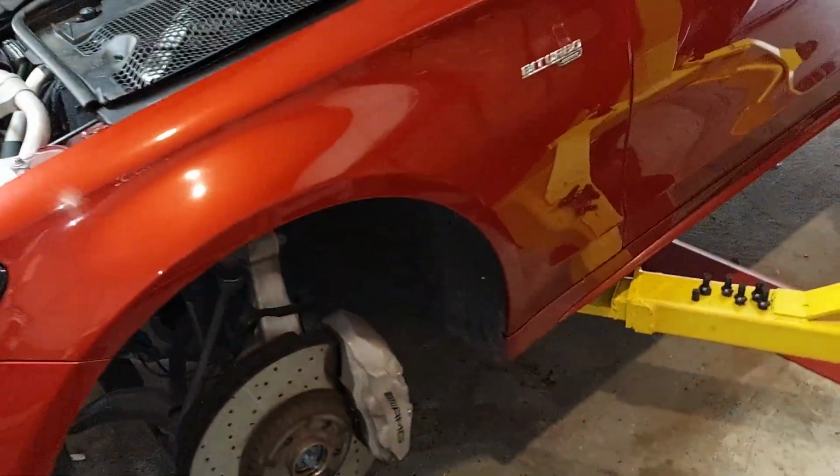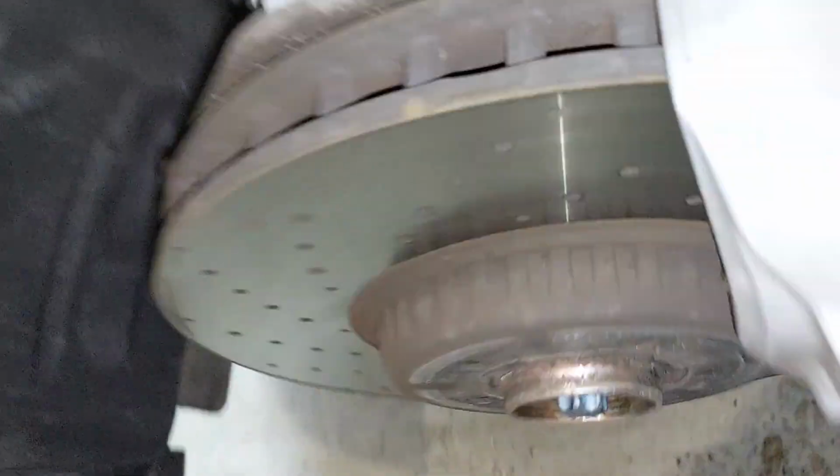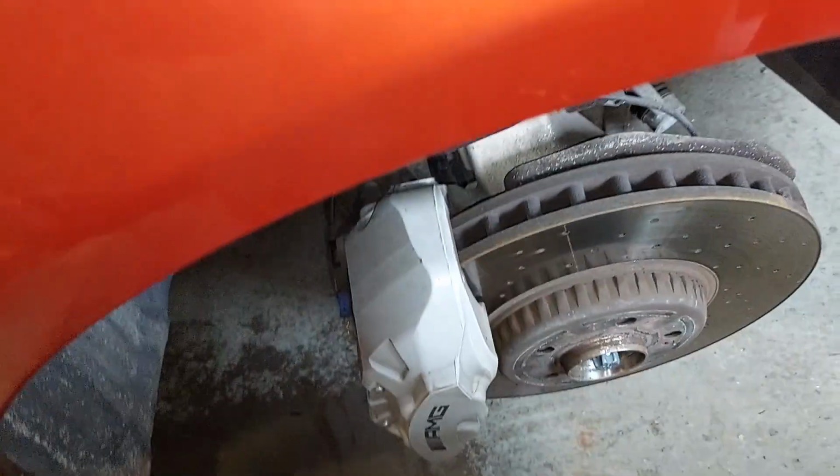And now we have the oil in the car. We're gonna start the car and depress the pedal a bunch of times. Okay, so we started the vehicle. We cleaned these off, so you just want to dry them off. We tighten them up, put our caps back on, go for a road test, and just make sure our brakes are nice and firm, just like they were before. Clean them off, put our caps back on. We still gotta put our wheels on, torque them, and then check the oil level.